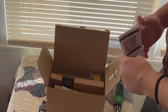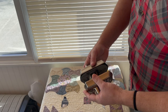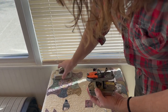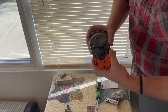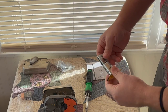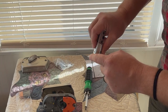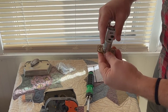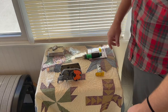Looking at the directions, you've got the assembly — the exterior and the interior — and you can see they're mated together. This is the faceplate, so I'll put that aside. What's important is that you keep this all as one piece until you go to put it into the door, so I keep it just like this so I know exactly how to put it in the right direction. Depending on your lock, you may or may not need this faceplate, which we'll determine — this just comes right off. It can slide in or it's got the mortised hole for the plate. That's everything you need to start installing this.